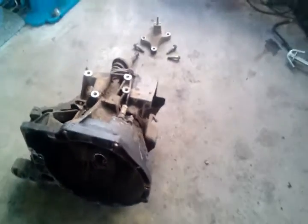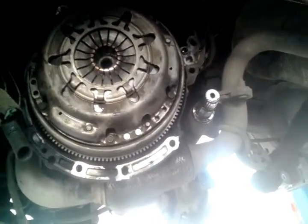We have lowered the engine with the transmission. Now we can raise the vehicle, remove the aluminium mounting of the transmission, and then we can remove the transmission. We now have to open these bolts here with 15mm range — there are three total and another one over there to remove the aluminium mounting. We have removed the aluminium mounting, supported the transmission, and now we can remove the last bolt and remove the transmission from the engine.